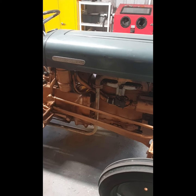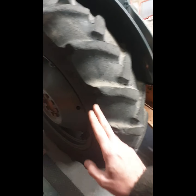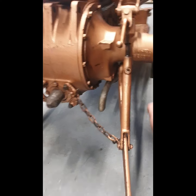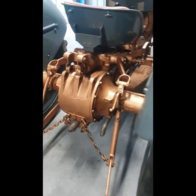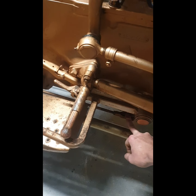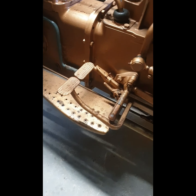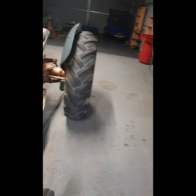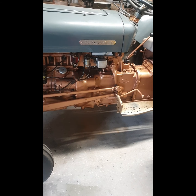I'd also like to take off the wheels, get into the brake hubs and have a good look around to make sure everything's okay. The brakes seem to work very well - I adjusted the rods to the same length on both sides, everything was basically three feet long, then made adjustments to each side to try and get the brakes pulling evenly. The approach has been to make the most of what I have mechanically without replacing unnecessarily.